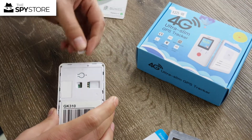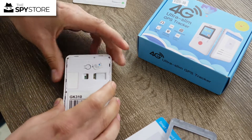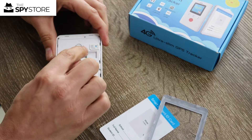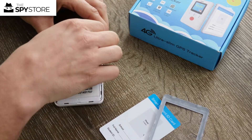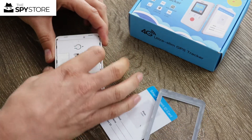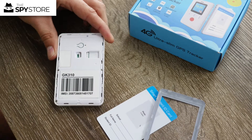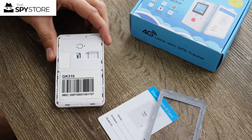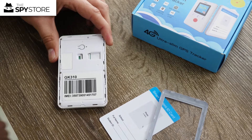Go grab your nano SIM — this uses the smallest SIM card possible, unlike the other two GPS trackers, this one uses the tiniest version. You want to install it with the cutout facing down towards the barcode, slide it in and push it all the way until it can't go any further. We'd suggest going with Telstra or Optus purely based on range and pricing, as it makes it easier to communicate with the tracker and run it at a lower cost.